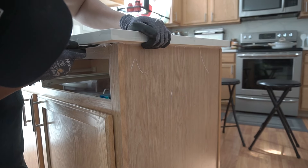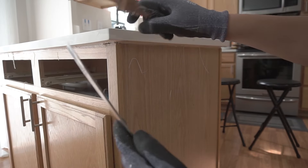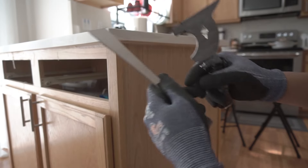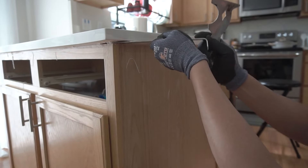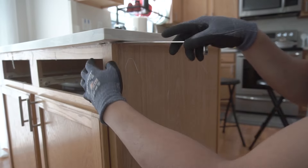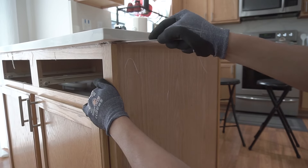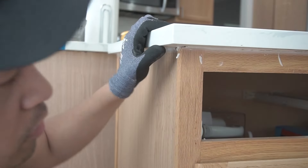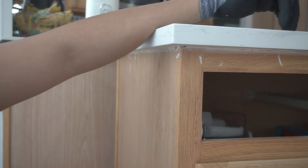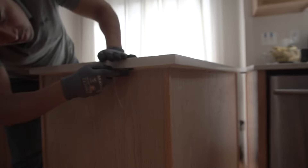You can also use this 10-in-1 tool. All the tools I use in this video I'll leave in the description down below if you want to try them out. I also have this little mini pry bar — great for getting up between there, perfect for corners especially where your knife blade can't go all the way through. Don't force things because there's a possibility this thing will crack. You want to loosen as much of that adhesive as possible; again, don't force it.